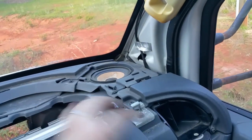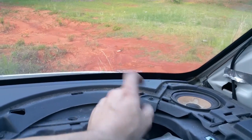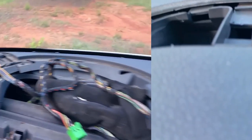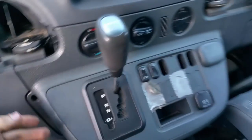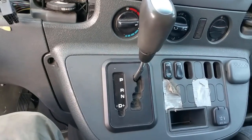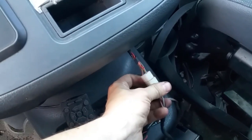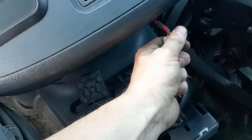This piece is probably holding that section the most. The most important thing for me is to try to get this upper piece off and see if there are any hidden computers or compartments. I'm going to remove these two bolts, then those two bolts, then work the other bolts around. The center console isn't really on there too firmly, so I'll go ahead and disconnect the ashtray — pull it out right there. It's hard to do with one hand but manageable.